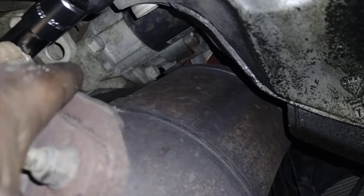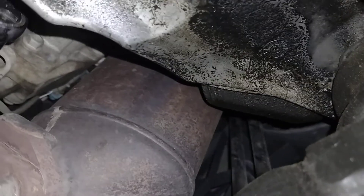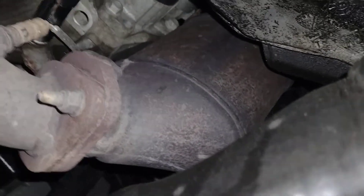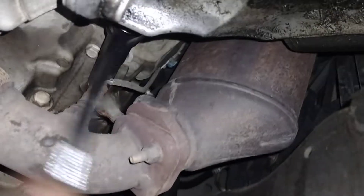The only thing I love about it is it's only held in by two bolts. I got an 8mm above the heat shield that I gotta pull off, then pull the wire off and unplug it. But why the hell did they put it behind the catalytic converter? When you do this job, you're gonna end up having to replace the gaskets whether they're bad or not — you might as well go in there and replace them.